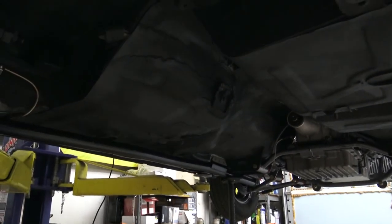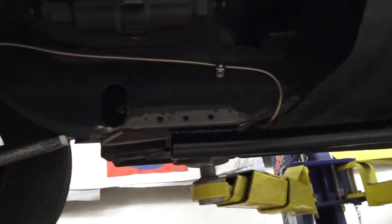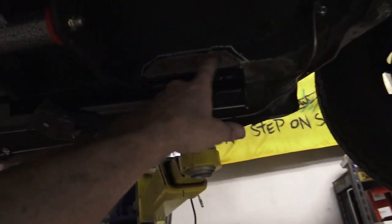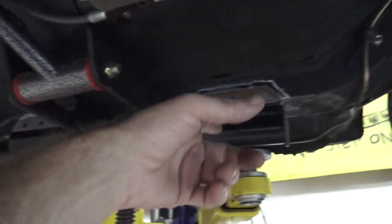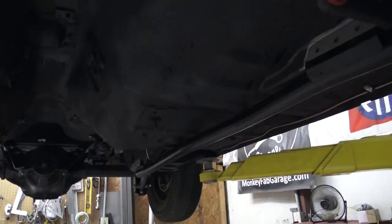All right, so we got our helping hand out here, and it's holding up our subframe connectors. These are really nice. It's Team Z, I think. Pete said he looked up their instructions, and they said don't do this. So I'm doing this, but just so I can clear these guys. I've marked them. I got most of the undercoating off, and I just need to strip that down the middle. MIG welding will pretty much burn through anything, but I'm just going to go ahead and do it right, all the way around that guy. We'll do the same thing for the other side.